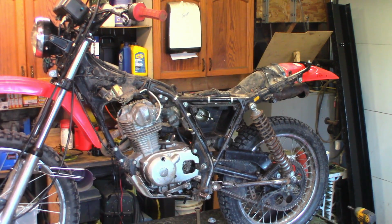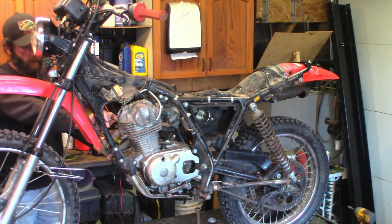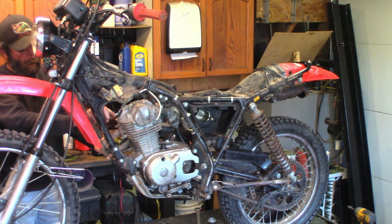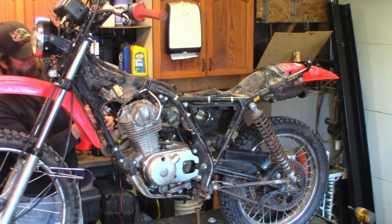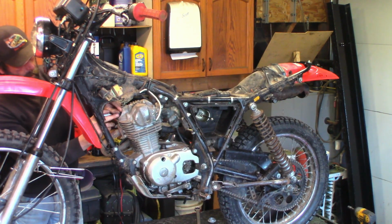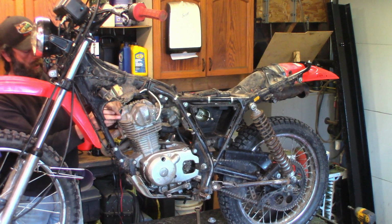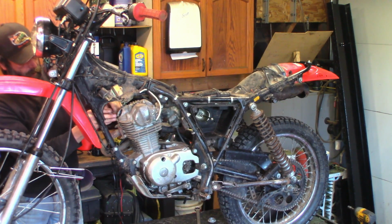We're gonna loosen a little locking nut. There's a little nut on there. We're gonna loosen that 10 millimeter nut, and we're just gonna turn a little screw down until we get roughly our 2 thou. You guys can't see, and it's useless for me to try and get the camera over here. Feeler blades could be better. These are kind of a weird one to adjust. They're very coarse threads. So tiny movements actually will tighten things up or loosen them up.